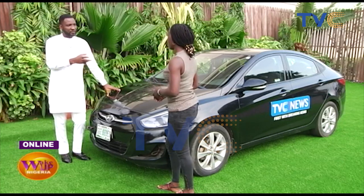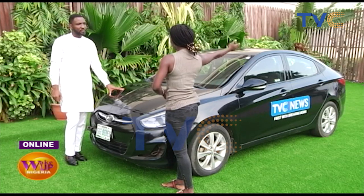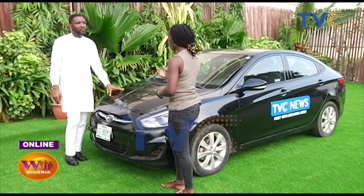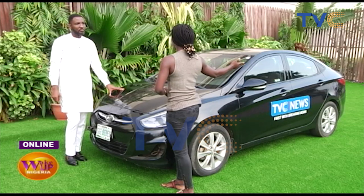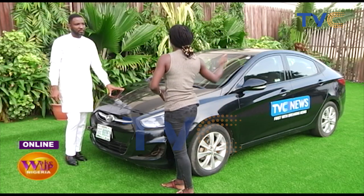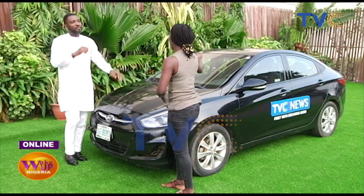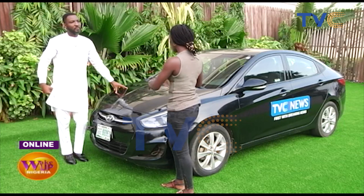Pay attention to what kind of wheel drive the car is — whether it's two-wheel drive or four-wheel drive. For rear-wheel-drive cars like some BMWs and Mercedes, you cannot tow them with the rear wheels on the ground. In that case you lift the back up, so the back is off the ground and the front is rolling. Nothing is going to go wrong that way.